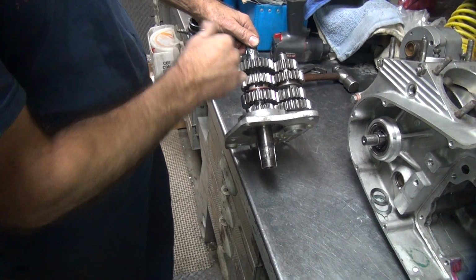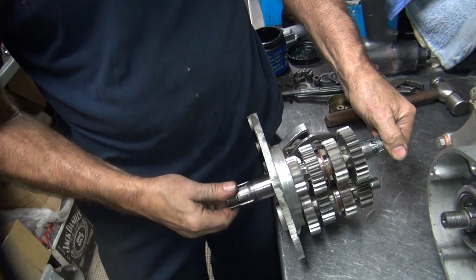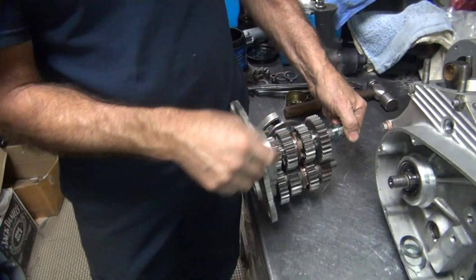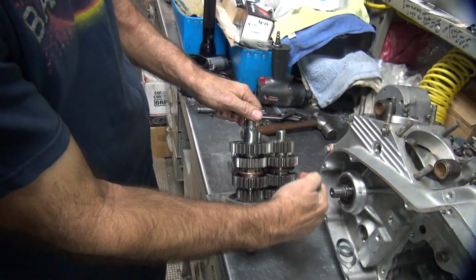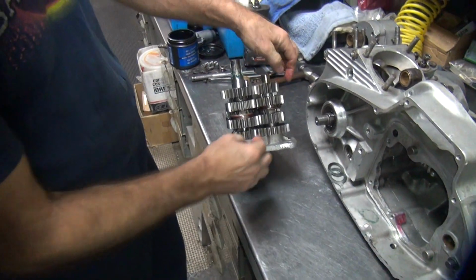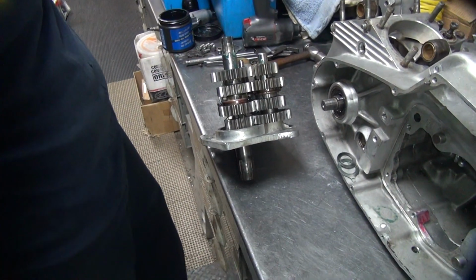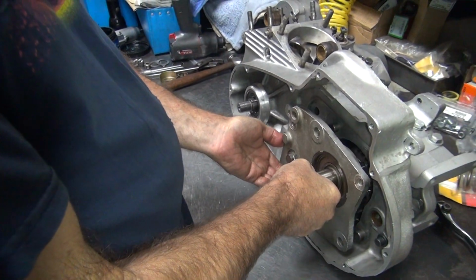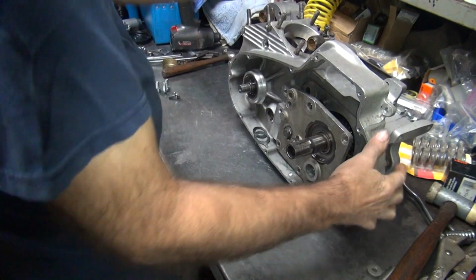Now my race bike, I burned this one up because this is up high. When you've got this turning 8,000 RPM, that's turning 8,000 RPM too on a steel shaft. It welds itself to the shaft. The oil's down about this level right here. It ain't up there. It's not turning and getting oil on, because these are turning, but not these. So it just burns them up. It's not getting enough oil flow. Not that I would ever run my bike in neutral at higher RPM for any time frame. Heaven forbid.